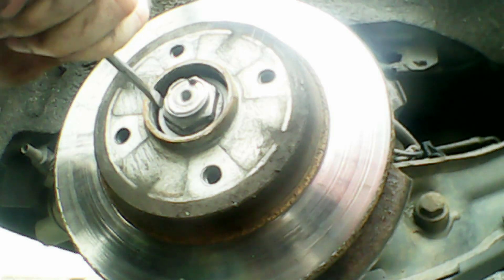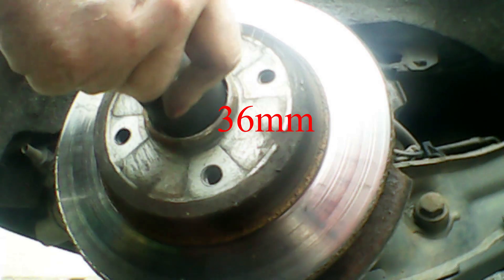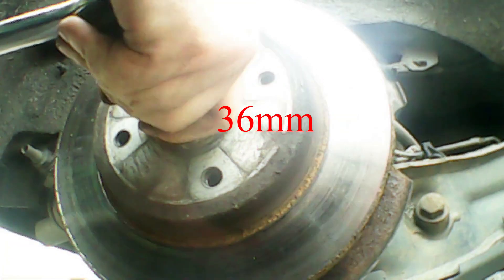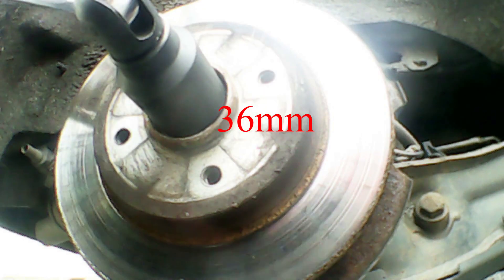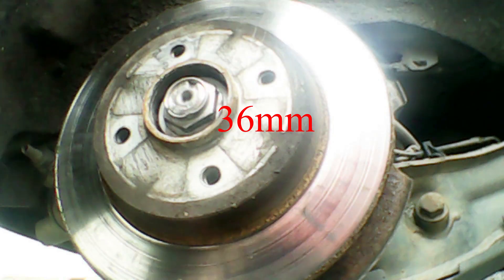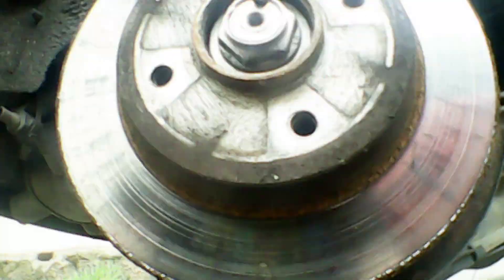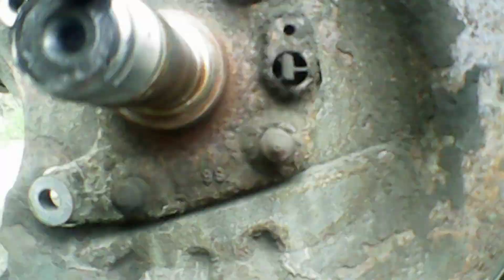Just want to make sure there's enough gap between the axle and the axle nut. I'm going to use a 36mm socket here — this is a 12-point socket; a 6-point would be far better, but there's a bit of slippage. Just get the breaker bar on it and with a bit of persuasion you can get it to bite in and move it. Once you get it to break loose it will move. This 36mm socket has always worked for all the ones I've done.